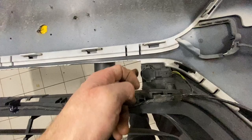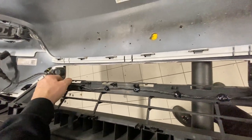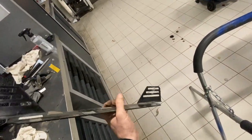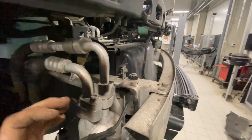Before I go home I'll probably just backfill these with some re-blast. They're a bit exposed really, but I had to have it like that — that's the only way this would go. You can't put it at the bottom because you've got the earth flaps there. The only place it could go was here. I drilled through it — there's a spring washer on the back, and a big piece of rubber so I didn't go through. I gave these a touch of under seal as well — not too much because they get hot in summer and they'll melt.